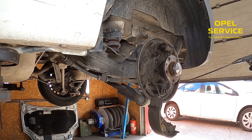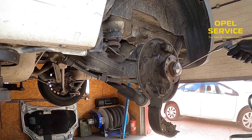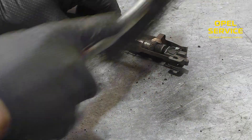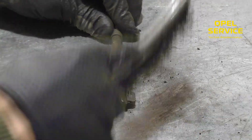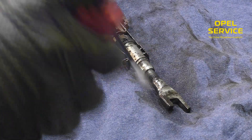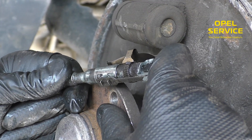This is a simplex type brake system. Let's take a look at the key interesting parts of this system. The spacer adjusts the clearance between the brake shoes and the drum. The automatic brake adjuster performs an automatic function of compensating the wear of the pad and drum surface.